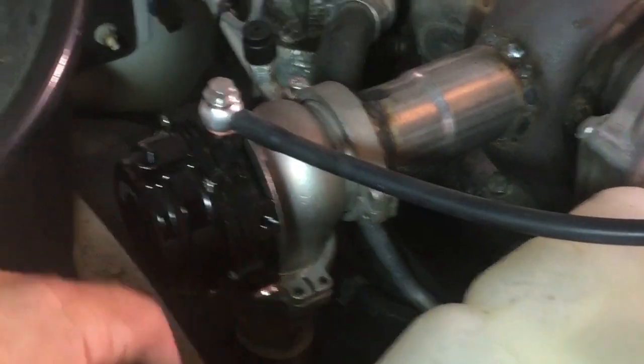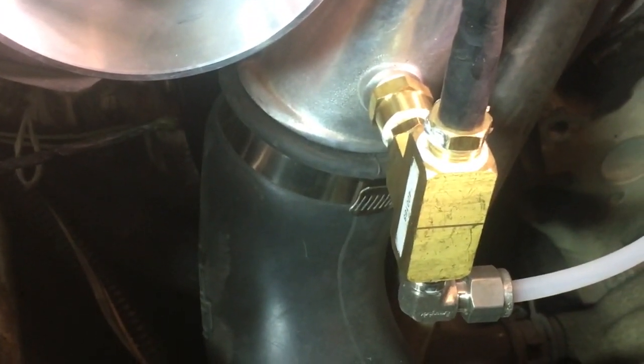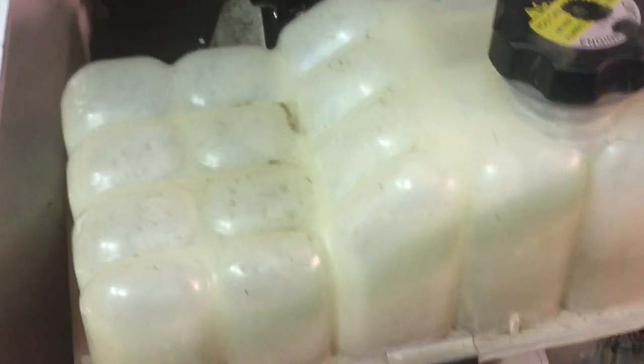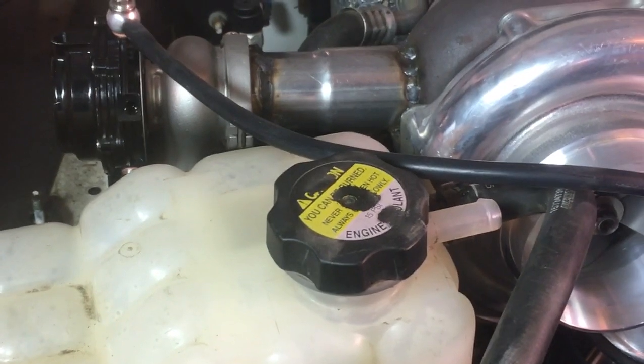So wastegate is in. I got that hole in the fender for the exhaust to exit and I've got this hose on. I had to put this little brass T-fitting on there to have another point to take boost pressure off of, and that runs over and actuates the wastegate. I've just got the low — like four pound spring — in there because I just want to run it low boost for now. I still got to figure out mounting this coolant tank more securely. But wastegate is on, so we're going to fire it up and take it for a test drive and let you know how it does in the next video.